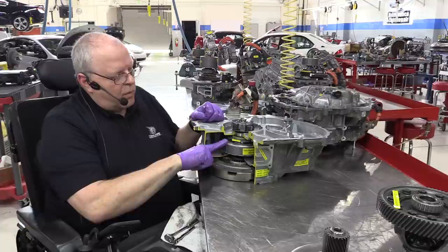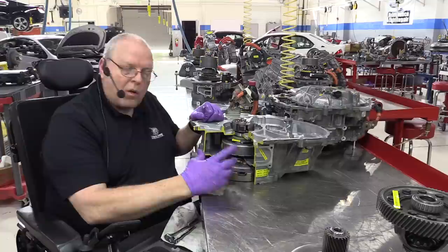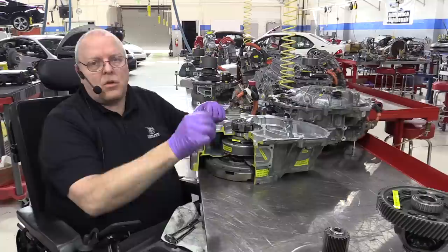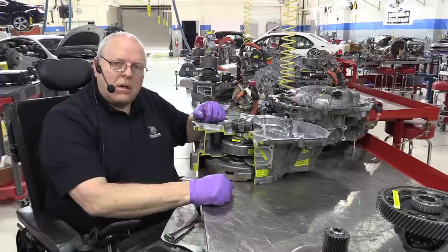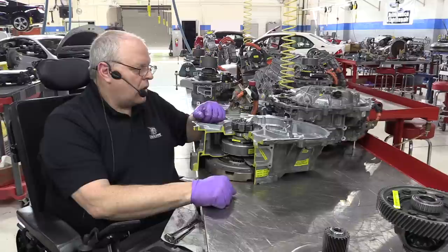And if we rotate both of them the same speed, the same speed and direction, then they're locked up and act as one, and can contribute torque to MG2 as we drive down the road. And then we can play with the rotational speed of MG1 to vary how much engine torque is added to the torque of MG2's rotor anyway.